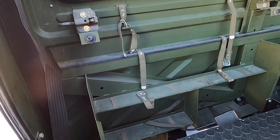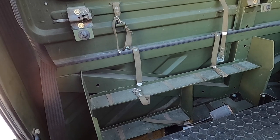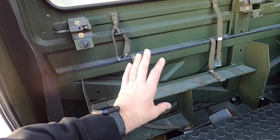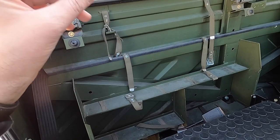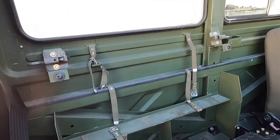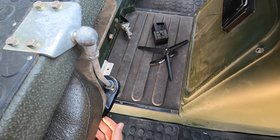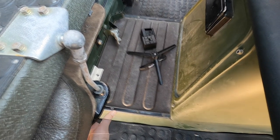There's not a lot of room inside the cab of a Unimog, but we have plans for this area. These seats are going to be replaced, and when they are, this area will probably house the electronics to convert the current 24-volt system into 12 volt — so accessories, radio, driving lights, fuse box will all be mounted back here. Eventually we'll be cutting into these to do a pass-through into our habitat. In case you have trouble getting the seat undone like we did the first time, there's a latch under here.